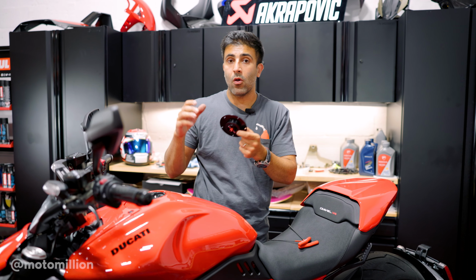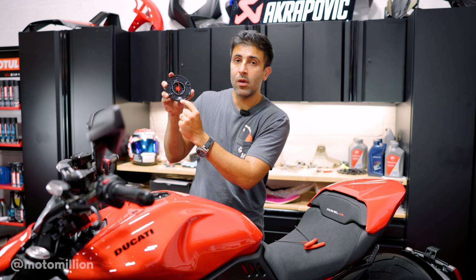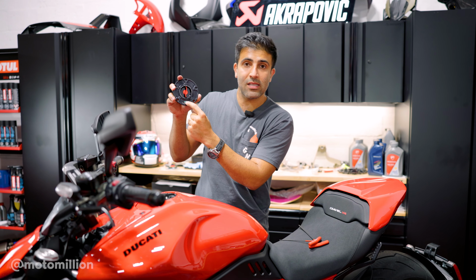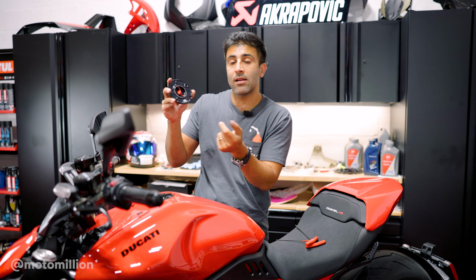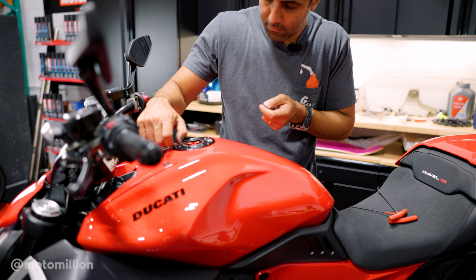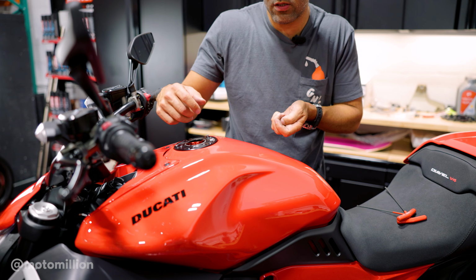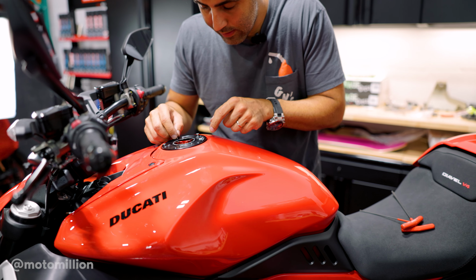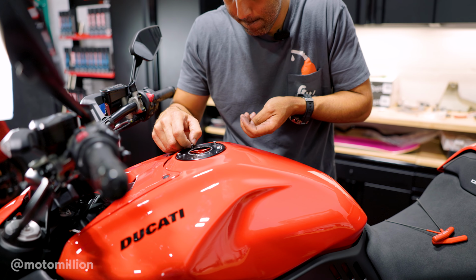And if you have everything oriented correctly, your TWM logo here is gonna be at 6 o'clock. And don't be alarmed, this Italian flag sticker, if you don't want it on your motorcycle, it's a sticker and it comes off. Try not to push down too much because you don't want those oval nuts to drop to a level that it's not gonna thread in straight.